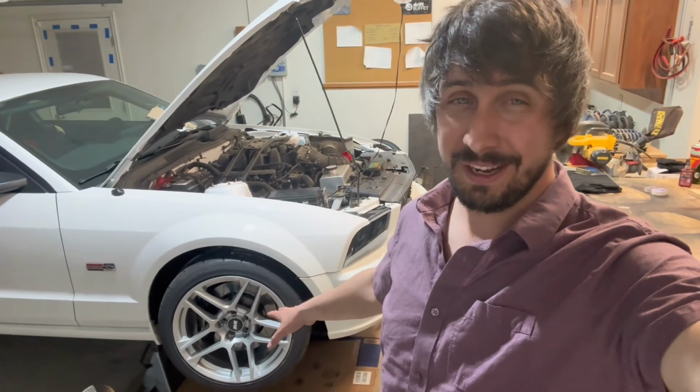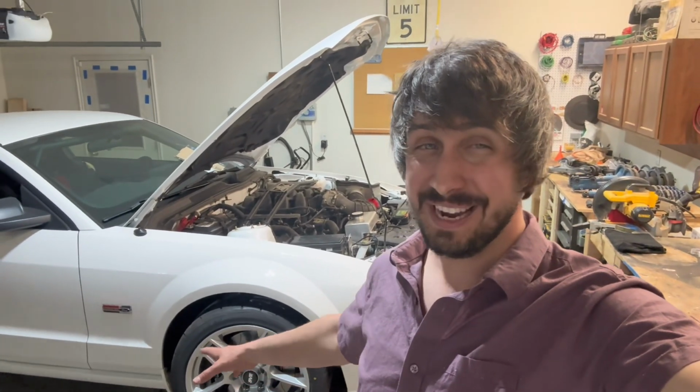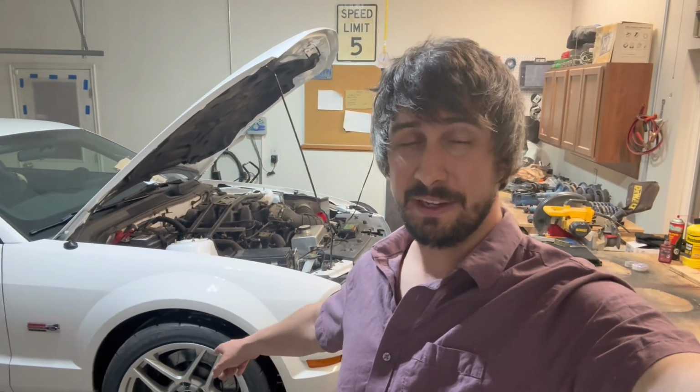Now, for right now, I have my street wheels on here, which are 19s. I think they're like a 19/10. I'm not going to run this wheel when I go drifting. What I do know from speaking with the owner is that he runs, I think it winds up being roughly 68 millimeters of offset, which is a combination of the offset of the wheel he runs and also a spacer. But what's awesome is with these 18/10s, before, the only way to not get them to rub with stock angle was running a 1-inch spacer.